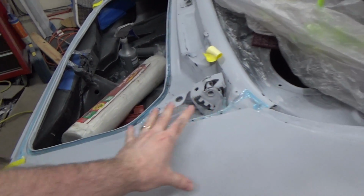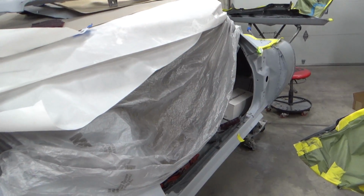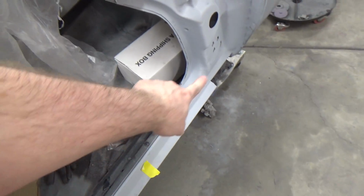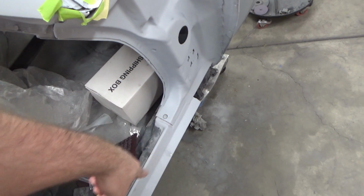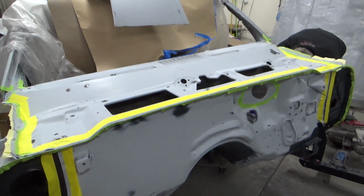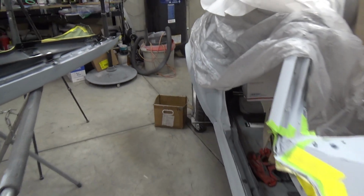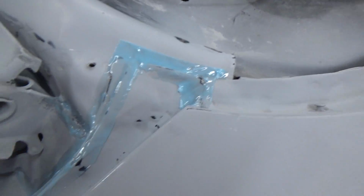This is the only tricky part right here, because the front of the car, we got hard edges everywhere basically, so it'll be pretty straightforward. So we're going to sand it back to here or so. And I remember we're just painting up this jam here, so we'll get a little bit of overspray on this, but it'll be sealed. This is all ready to go for seam sealer here. I'm going to use the brushable stuff, as I said, because that other stuff is a nightmare. As Pop said, it's a really pretty color when it's dry. It's a really nice blue. This will all be covered up, but...